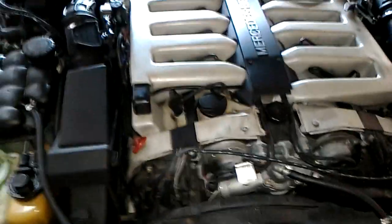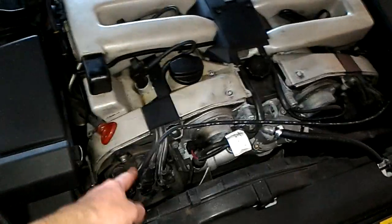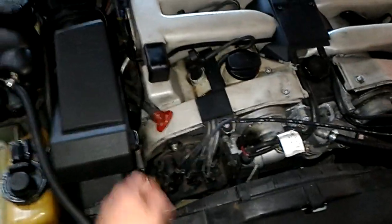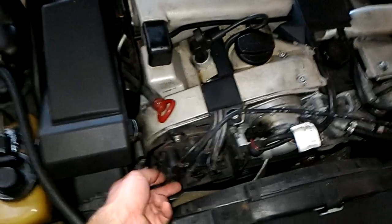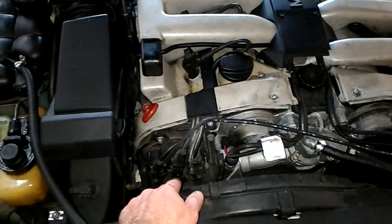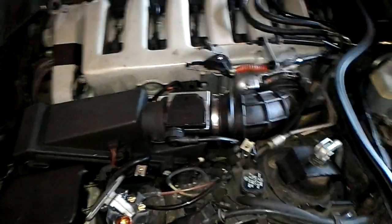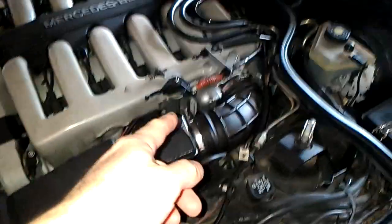In terms of caps and rotors, they both need to go. Ignition cables are a job too. I did remove all the plugs and wires off the cap — they came off except for the center one, which broke right off. We can leave the ignition wires for now, but caps and rotors definitely have to be replaced. Then I'll go over the mass airflow sensor wires.